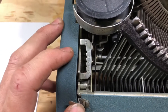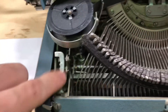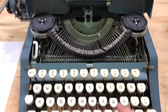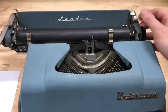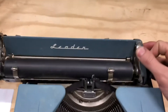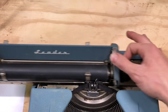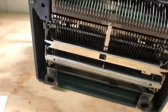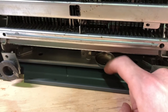Here is a touch control, except there's nothing in there — this appears to be a vestigial part. If you know better than me, put it in the comments. All the keys are fairly sticky, so that's where we're going to have to start with this machine. And while working the carriage back and forth, usually when you come to the end of the page you're supposed to get a ding — so that's weird. I'm not sure why the bell isn't working. Let's make sure there is a bell. Yep — so we'll have to figure out why it's not dinging.